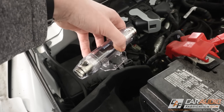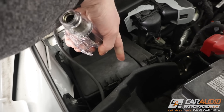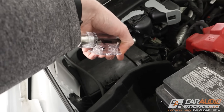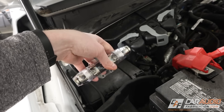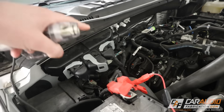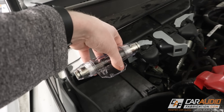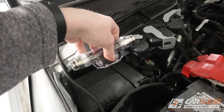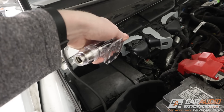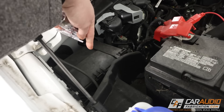The other thing I try to avoid is having the inline fuse right above the factory fuse block. I see a lot of people do this — sometimes people will drill holes through the top of that box. Try to avoid that if you can. Obviously in some engine compartments there's hardly any space to work with, so sometimes you do have to go above something and just undo the inline fuse if you need to access whatever is below it. But if you can, and I think I can in my situation here, we're going to avoid blocking that out.